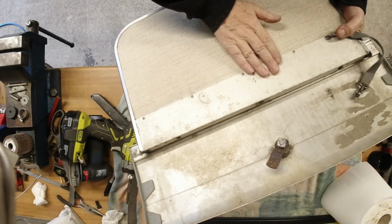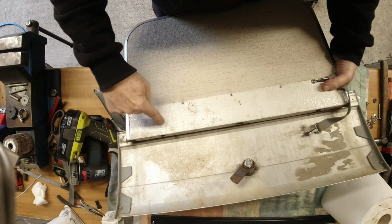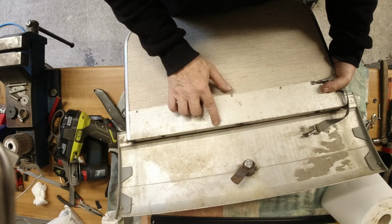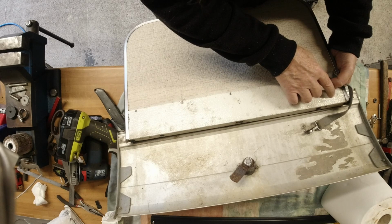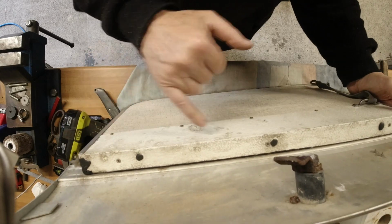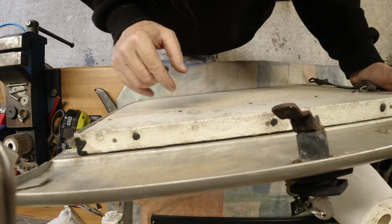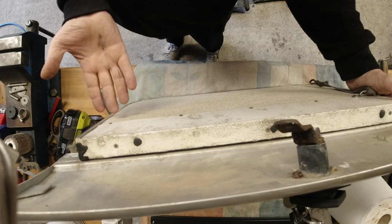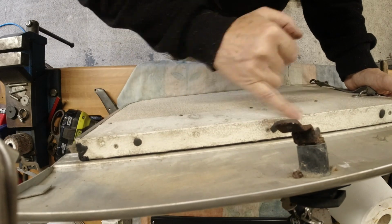It doesn't look like they came out on the back side here. It would be the center of that one, so they would have come out. I think I can just feel it there, protruding. I don't know whether there's a small little bit there, but they're tight enough. I don't want to make them any tighter. And I don't know if you can see or not, guys, but look, we've a nice seal going on in there, so it stops the water. I've put 3 little bits there where the old screw holes were. No one's going to see. I'll take those up and I'll put Sikaflex on there.